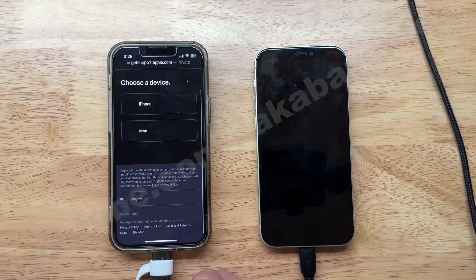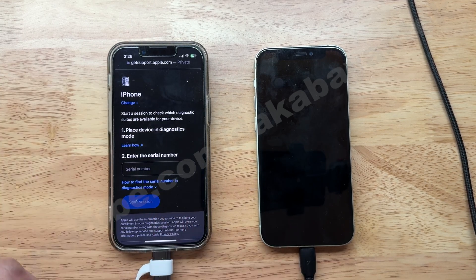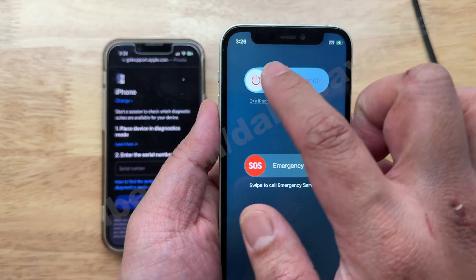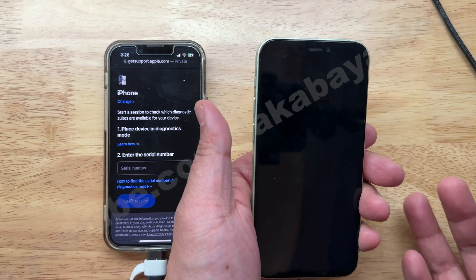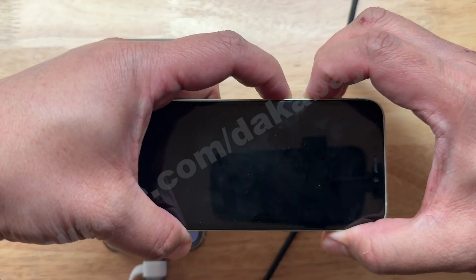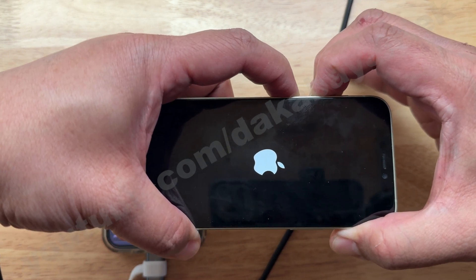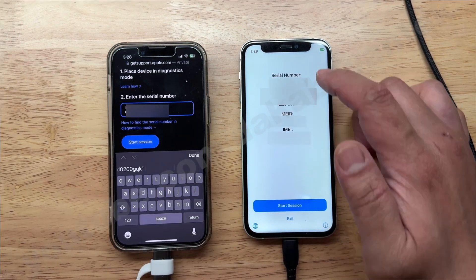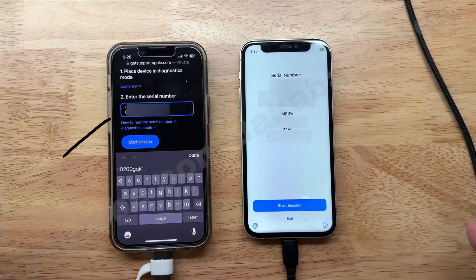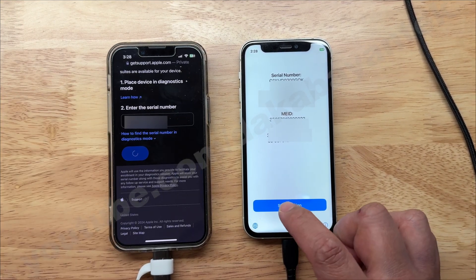Let's start with a private browser and refresh it. It will ask you if you want to test an iPhone or a Mac — I'm going to use an iPhone. This will ask for the serial number of the device. We're going to turn it off, take out the charger, let it sit for 5 to 10 seconds to fully shut down, then plug it in again and press the volume up and volume down at the same time. When the Apple logo shows up, I count 10 to 15 seconds before releasing, then let it run by itself. It goes into diagnostic and repair mode. Once you press the I button it will show the information — you enter the serial number, do Start Session on the website, and also Start Session on the phone itself.